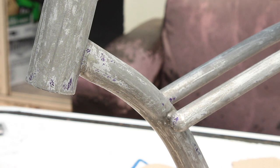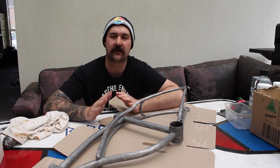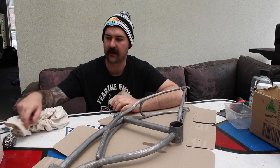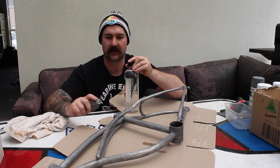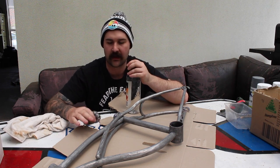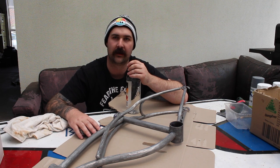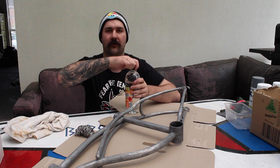We've got most of the purple off the frame. It doesn't need to be perfect, just nice, clean, and smooth. We're going to go over it with steel wool and a bit of mineral turpentine to clean up and even everything out, then go over it with sandpaper, and then we'll be ready for our undercoat. Very excited — let's keep moving and see what our results will be.